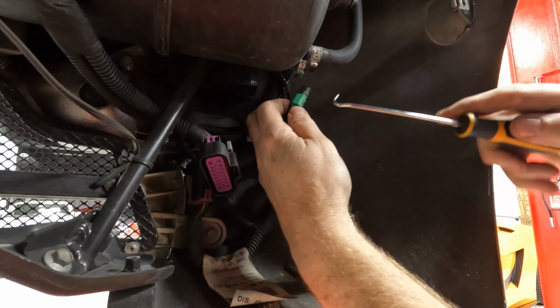All right, so this is what I'm talking about. If you look straight in, they still need to go that way. Also tilted slightly, so I need to beat them with the hammer a little bit. Let's get the bumper fully mounted first, because it might move just a tiny bit, and then we'll beat those into place. There we go, a couple taps of the hammer, and now they're nice and aligned straight. So that means we can clamp it all down. Bumper's on. Gotta reconnect the bumper. Well, shit, I screwed up.